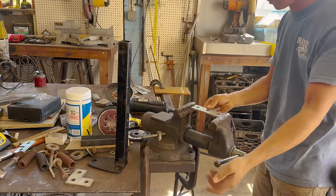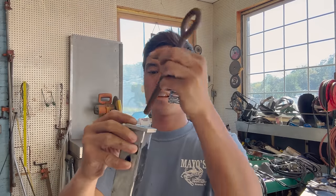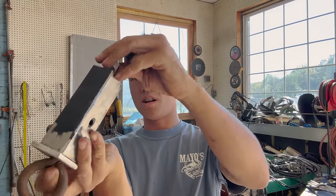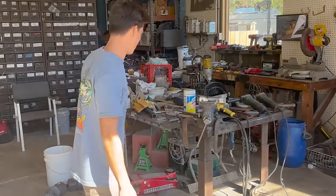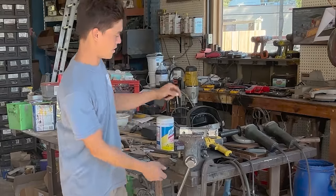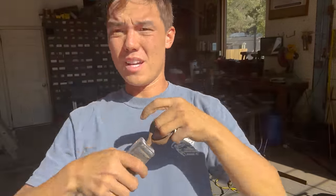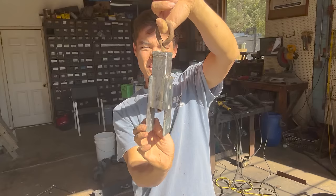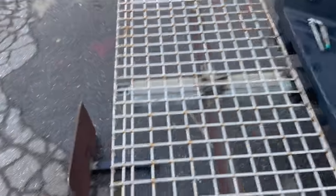I need to build shock tie-downs to hold the camper to the truck. Got a bunch of these — cut these tabs off, use that for the top, use the rest on the bottom to weld to secure it. We've got a piece of square tube, an eye bolt, a spring cap on top, eye bolt through it, spring on here, a washer and a nut, and then tabs. So when you pull up on this, it's got tension — it's in case you hit a big bump and don't rip the tie-downs out of the camper. This thing will absorb the shock so it's not hard-mounted to the truck. You can buy these but we just built them out of scrap metal, and got them all painted up. Also built this little porch — it's definitely not made out of a pallet rack from Home Depot. It's got a little step on it too.